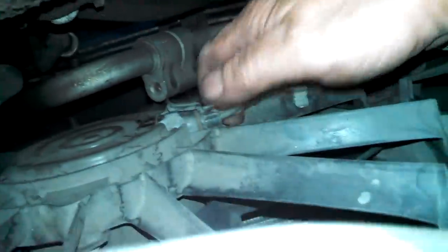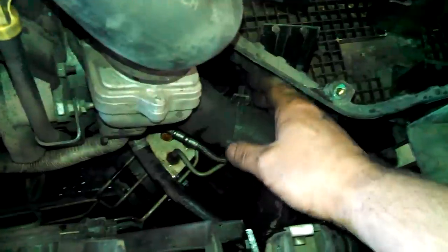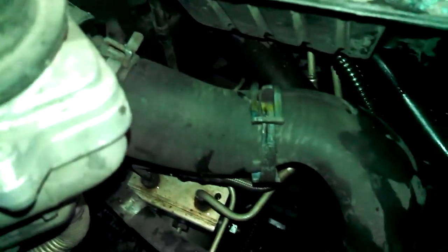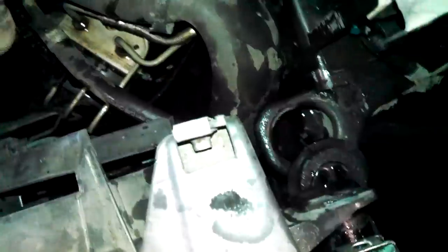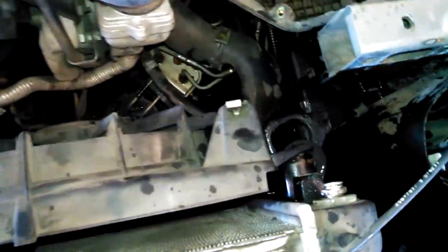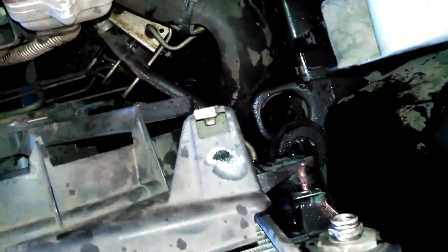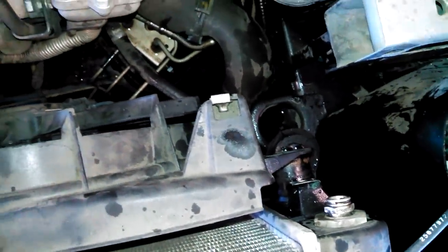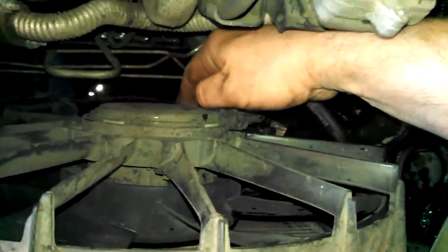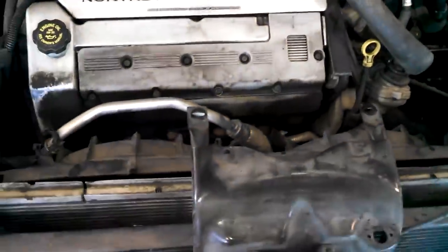You can probably now reach down here and unplug the cooling fans — a couple of clips here to hold them in place. Pull the hose off. Once you clamp it down far enough it seems to stay in place — it's pretty messy. Here's where the radiator sits. I pulled it up and out a little bit just to give me more space with the cooling fans to pull them out. They just sit in little notches down there. Let's get the lower hose off for the transmission line. Yeah, just have to unplug these and pull the harness off. Certainly do not forget to hook those back up when you put your car back together.